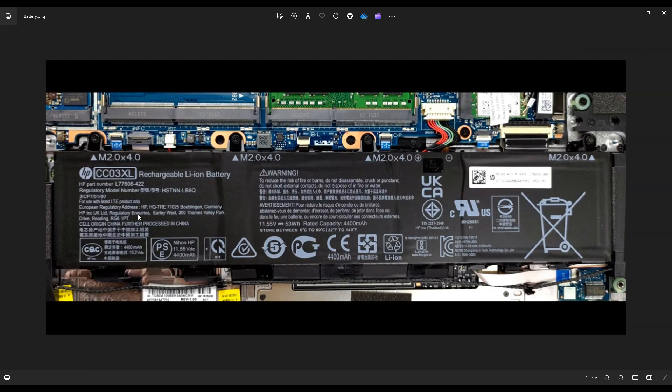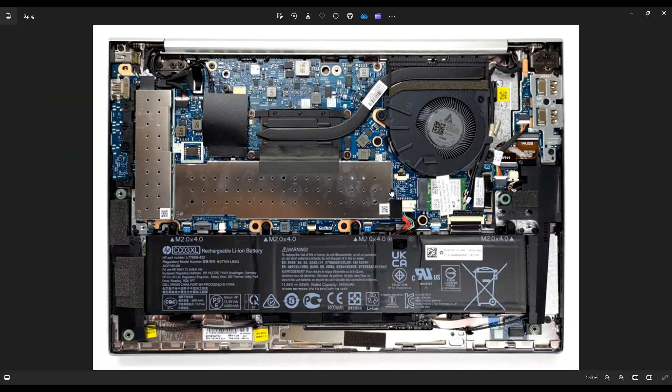Here's your main computer battery right down here. There are four screws holding this battery in on top — one here, one here, one here, one here. In order to get the battery out, you also have to take the speaker wire here. See how the speaker wire goes along the bottom of the battery? That's kind of stuck in there, so you've got to make sure that the speaker wire is not connected to the battery before you just rip that battery out — you could damage your speakers. After that, this is your battery plug right there. Some of you may have a black piece of tape over it, and when the computer was first opened, you may have to bend that black tape back a little bit.